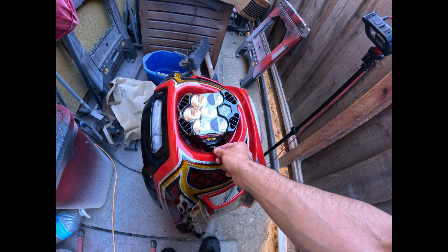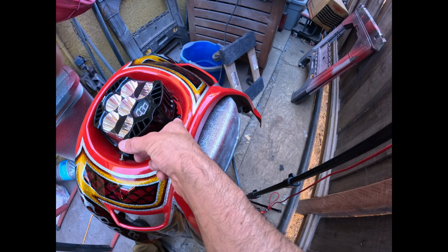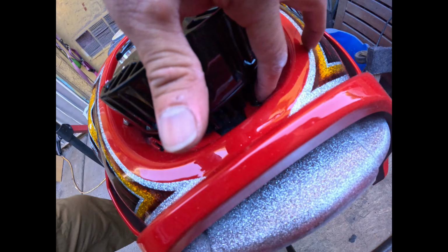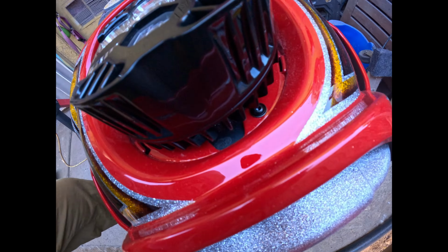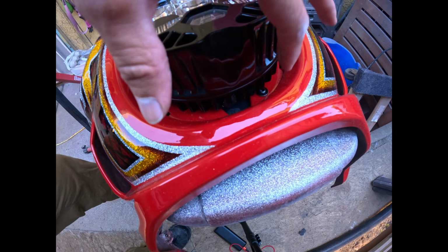So that's pretty much the end of the video, only because the GoPro's not working. And we just lined that up, tying down these bolts. Like I said, you need to use half-inch length, quarter-inch bolts on this. And then of course on the bracket, on the fairing, we're using the Allen head. You can see how tight that is. So for that reason, we're not using the regular bolts. You have to use an Allen head bolt, so you give yourself enough clearance for your LP6.